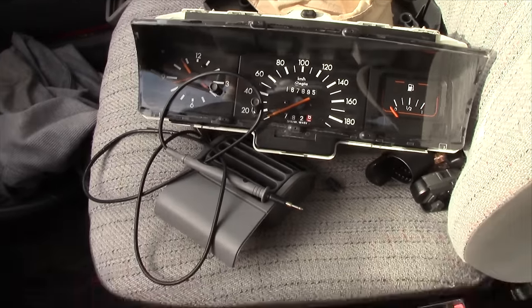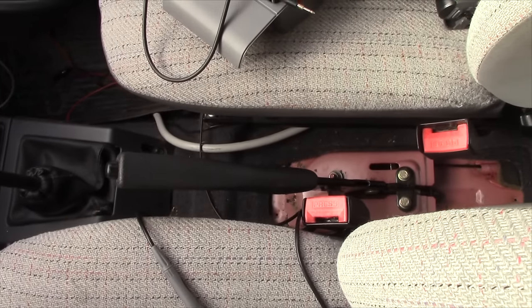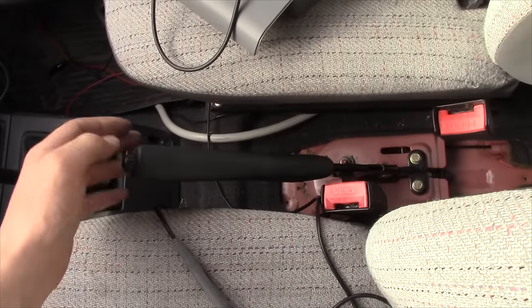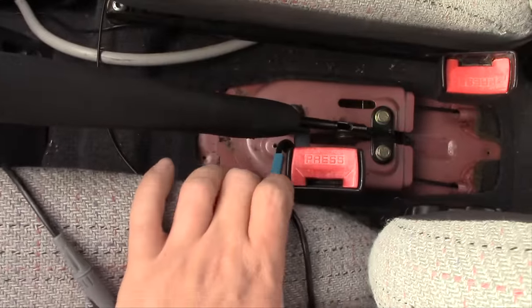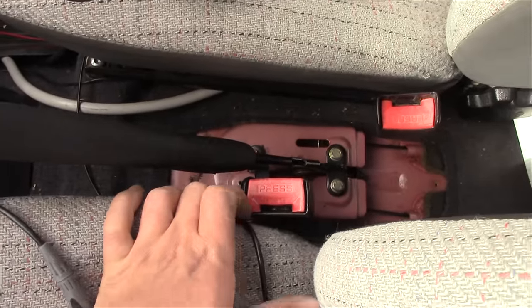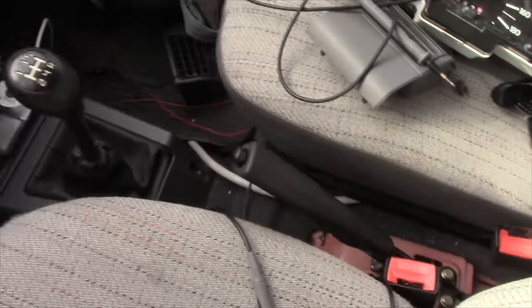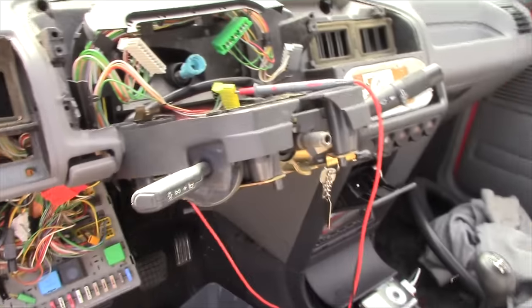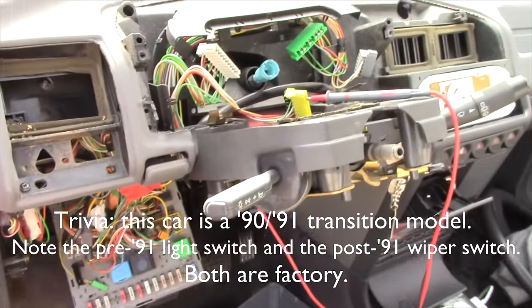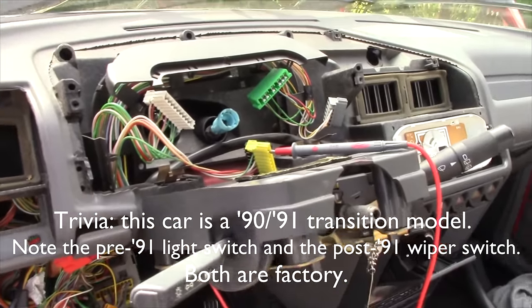At first, racking the parking brake lever about made the problem go away momentarily, so I figured maybe the switch is stuck. I took that apart, cleaned it out — it reads fine. Then I took the dash apart and checked if there was a short to ground between the switch and the dashboard, which indeed there was not.